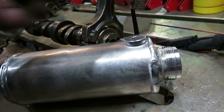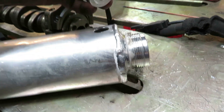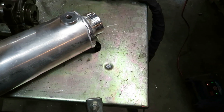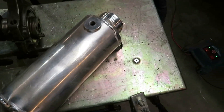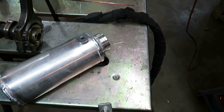Working on the overflow tank for the S10. I literally had some old aluminum pieces laying around — it's got that on the bottom side. I cut a hole that it'll fit, about to weld it on, and then I can thread it for eighth inch MPT and run a nipple on it. Once I get a nipple on there, I can put a hose on it for an overflow.